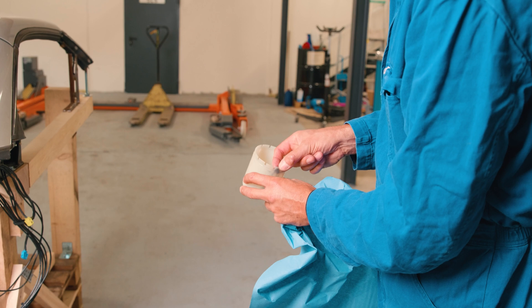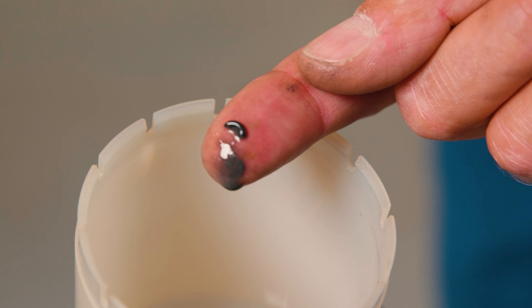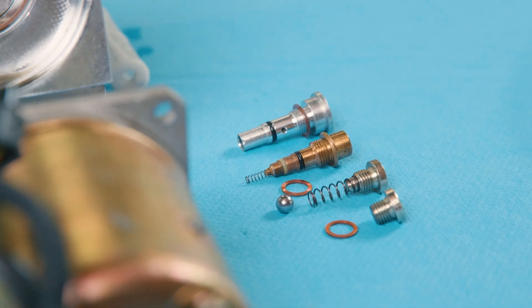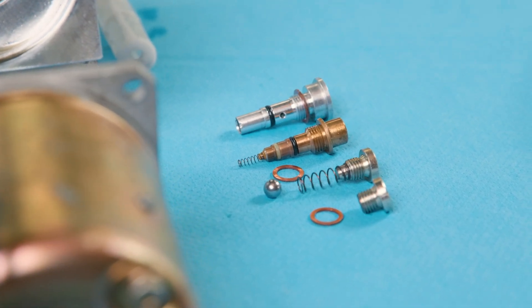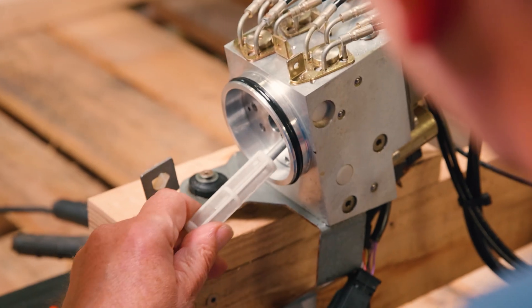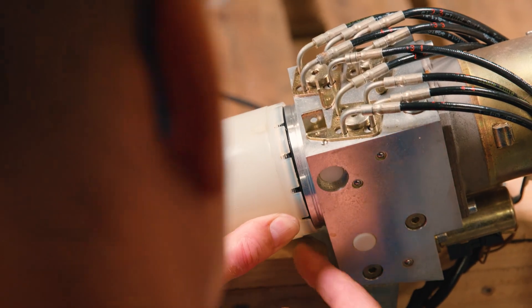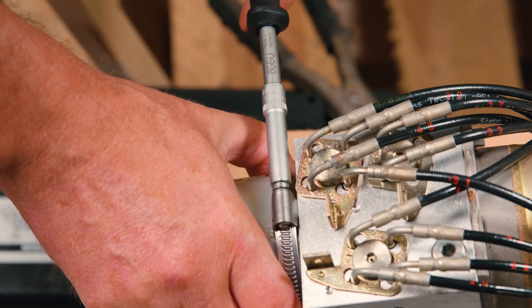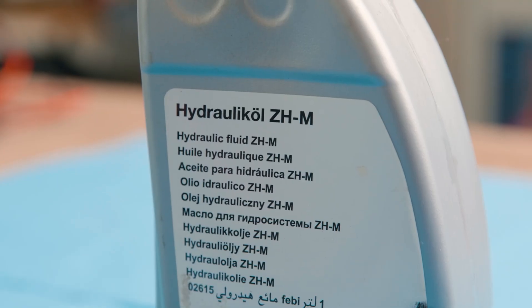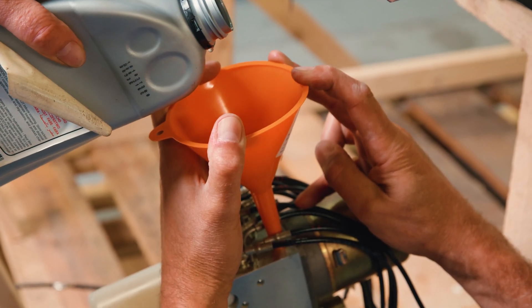There are also solid particles in the oil. The emergency valve screw has two quite small O-rings, and the warnings about mishandling them are well known. During reassembly after cleaning, the same work on the installed car will be more difficult, especially when carefully repositioning the reservoir. The fill screw on top is M10, which is suitable for a small hose or funnel. Oil brands with MB Approval 343.0 for ZHM applications are readily available, and the small R170 roof hydraulics requires 420 milliliters, about half of which doesn't appear at the oil change interval.